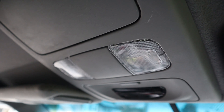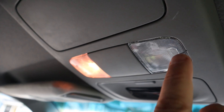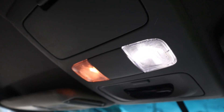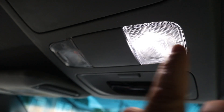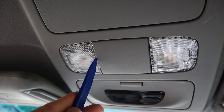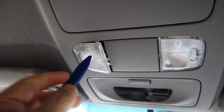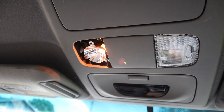When it comes to the map light it's a little bit trickier. I did one side already and I'll show you the difference — this is the incandescent bulb and this one is the LED bulb. You can see that's quite a bit different, it really illuminates the cab quite a bit. The trick is to do the inside first, so take your pry bar again and push it in and pull that out, then go on the other side and pull that out — and that's it.